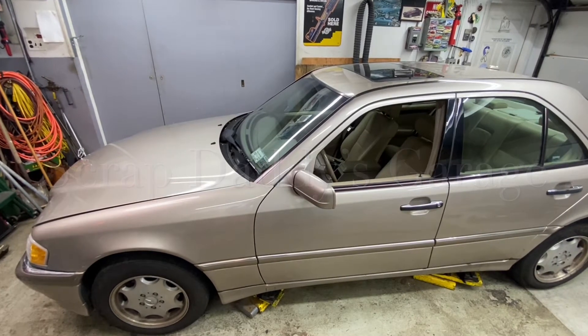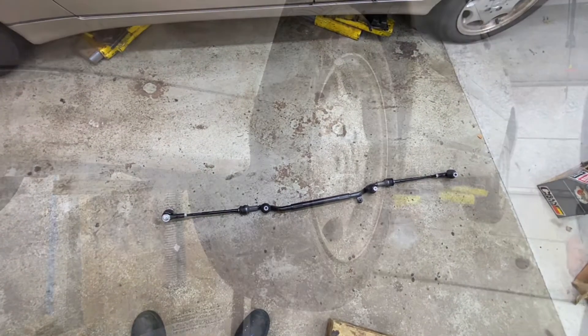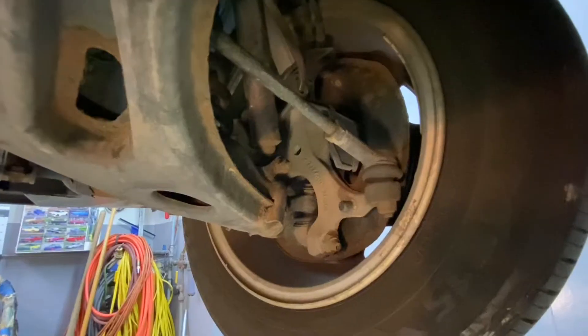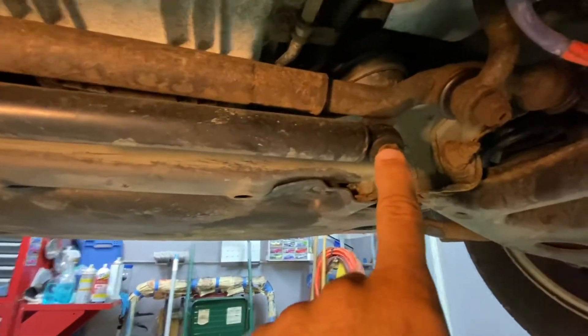Welcome back. The rat-infested Mercedes is back in the garage today with some worn out steering components. We're going to be swapping out the whole drag link and tie rod ends assembly. One of the inner tie rods is really worn out — the boot's torn, it's got a lot of play in it, and the other one's not too far behind. So the best thing to do is just replace the whole entire assembly. The tie rod ends need to get disconnected on both sides. The difficult ones are going up to the steering arm and the idler arm. There's also a steering stabilizer bar bolt to pull — this part could stay in the car, we only have to undo one end. Got to get the tires off first and we'll get started.